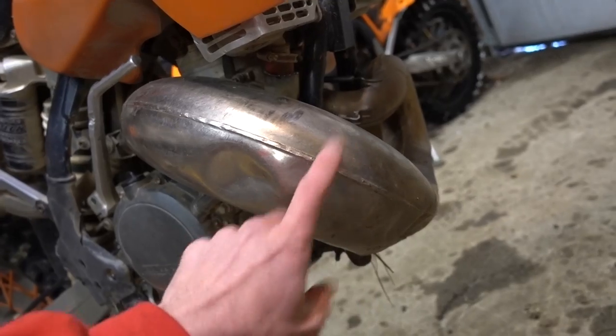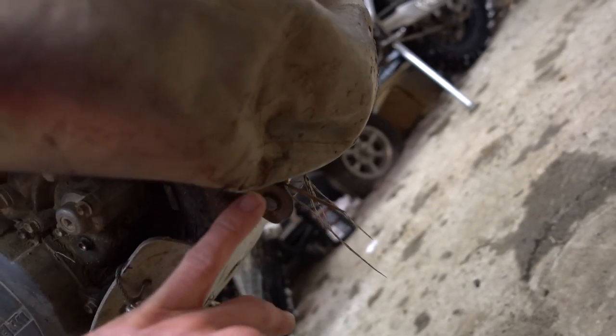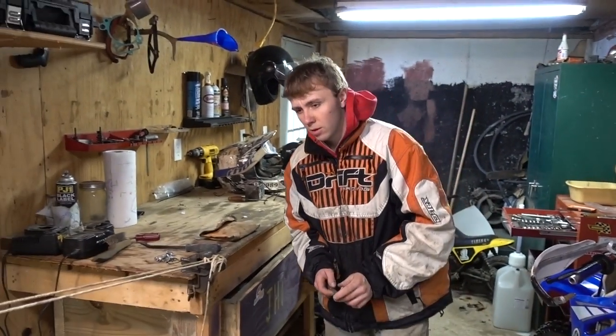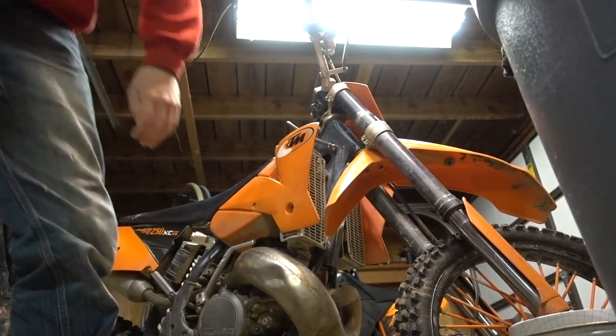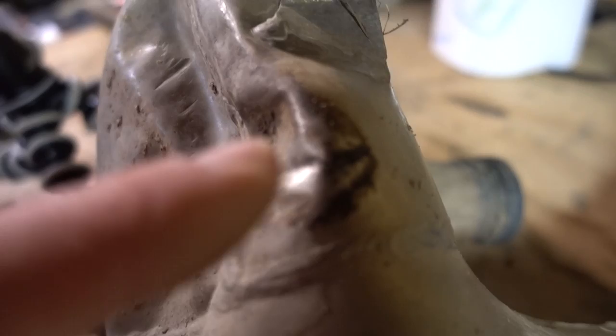The reason I'm visiting Jake right now is to harvest this muffler off my bike. There's a dent — I want to take this dent out because there's actually a crack right here and I want to weld it. As you two-stroke fans know, the expansion chamber is like the most important thing on a two-stroke. Jake, you going to give me a hand taking this expansion chamber out? First two-stroke muffler uninstalled — complete. Here's the crack. I'll probably pull this dent out first and if I make any other cracks, we'll go ahead and weld those up too.